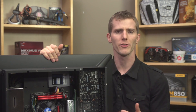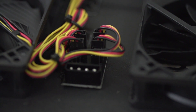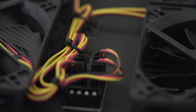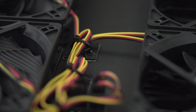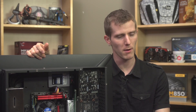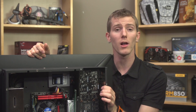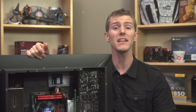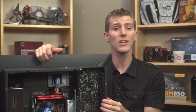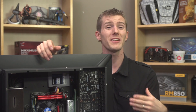The number one concern I have about any compact gaming machine is thermals. We saw this with the ASRock M8, which is a similar size but doesn't strap to the back of a monitor — that one uses 60mm cooling fans which in stock configuration cause a GPU of this caliber to throttle even at stock frequency. So I wanted to put the Crate to the test. My opening salvo was Furmark: the GPU rose to 80 degrees, which is perfectly normal, but impressively it was still running at over 900MHz boost clock — the advertised average boost clock of a reference GTX 780. Either EVGA's ACX cooler or the chassis cooling is doing its job very effectively. This is a very solid result, and heat is not an immediately limiting factor like it would be in many cases this size, such as the aforementioned ASRock M8.